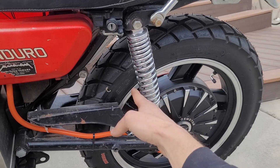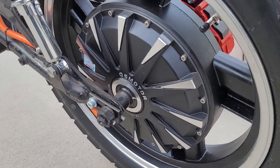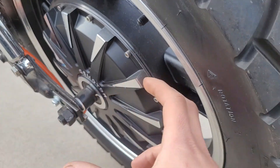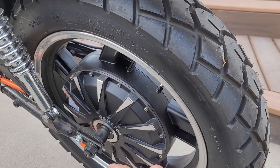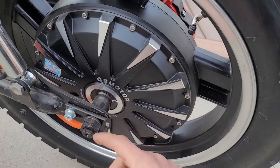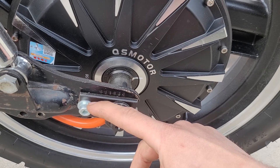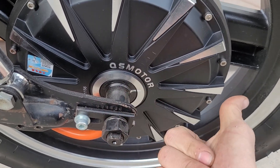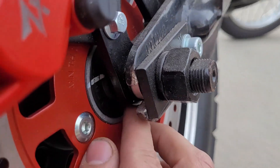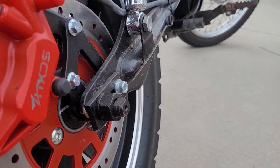I also got new rear shocks. To get this hub to work, I had to modify the swing arm — I had to cut out a slot here because this axle on the hub is not removable, so I had to cut a slot to be able to slide it in. Then I built a little torque arm bracket to retain it so that it can't pop out the back end. Likewise, I did the same thing on the other side: cut the slot out, put the axle in, and put the torque arm there.